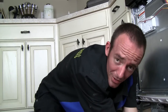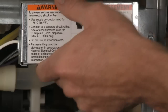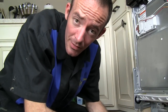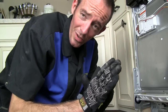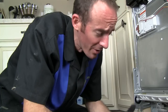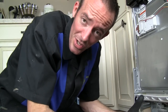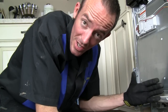Be very cautious with wood floors — obviously scratches from moving the dishwasher out, and also leaks, especially when reinstalling. It is very important that the dishwasher be level, especially from front to back — dead straight even with the cabinets, or tipped back just slightly. There is no bottom seal on a dishwasher in most cases, and if there is, it is a light one and not waterproof. If the dishwasher is tipped forward, the waves created from water circulation can cause water to run up and out of the front as it surges in the tank.